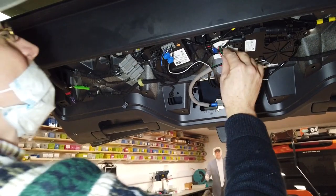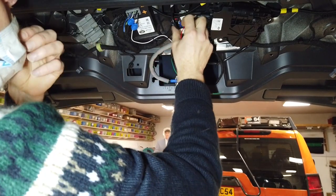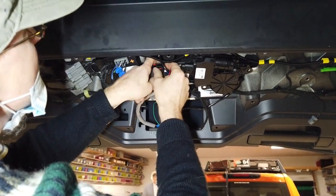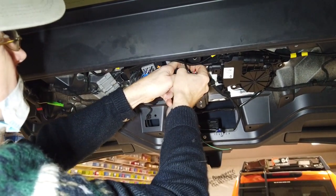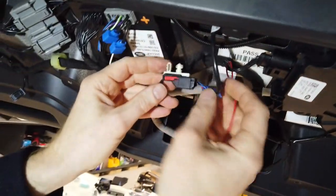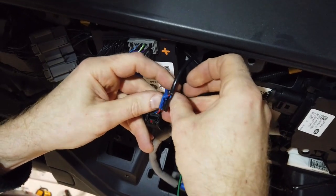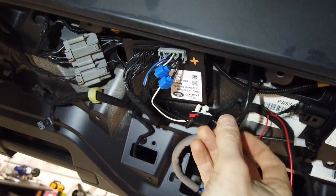The next wire is the green. The green is what is going to come on with your tail light, and this goes to this little connector here. Let me see if I can unclip this connector — there's a bit more room to maneuver. It's just on a little barbed connector with two positions, so that will give us a little bit more room.